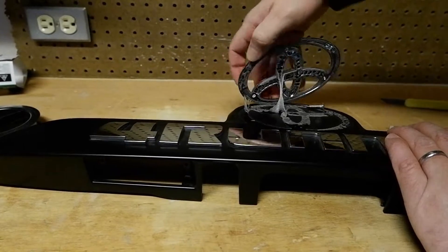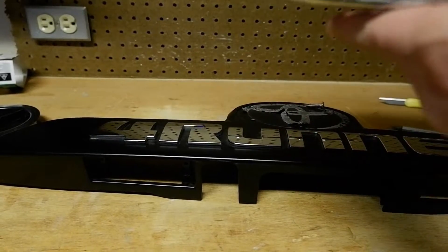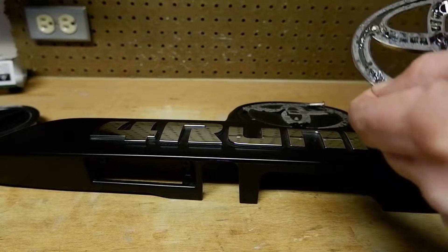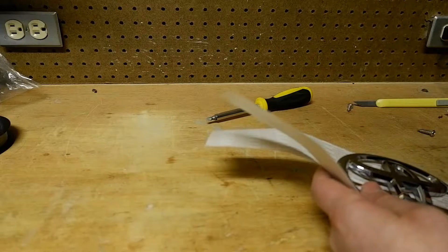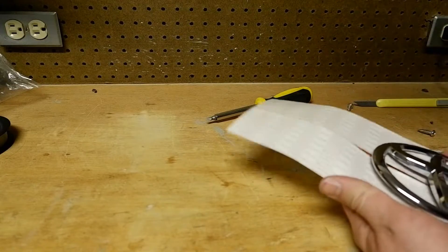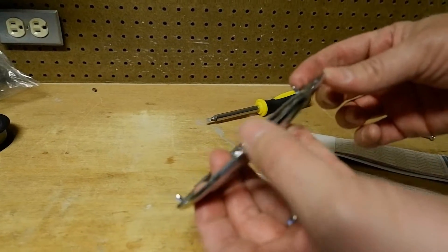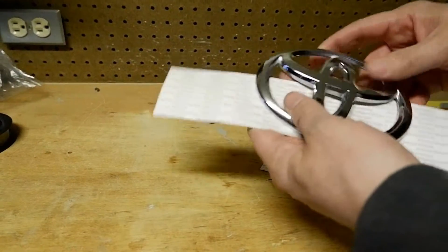See my glue? Yuck. That's what it looks like. Remove as much glue as you can — it's not 100% imperative that you remove all of it, because the press-in-place will apply a nice glue layer on top of what's already there. Using 3M press-in-place — this stuff is awesome for putting on car decals. There are these two little alignment pegs that stick out; I wouldn't recommend removing them because they allow you to get the logo on nice and straight.